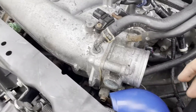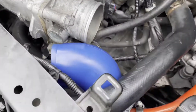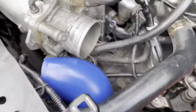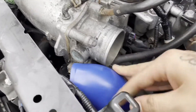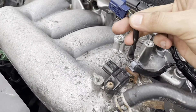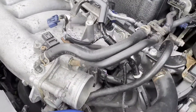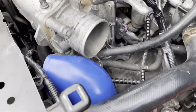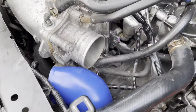I'm gonna attempt to cheat my way past — I'll just leave this to the side. I really don't feel like taking the whole intake out since it goes all the way down there. Now that we've got the intake out to the side, we want to work on these bolts right here. I unclipped the hose — you don't want it being tugged or ruined. So we're gonna remove these four 12-millimeter bolts.